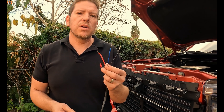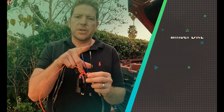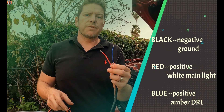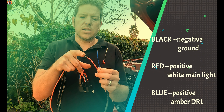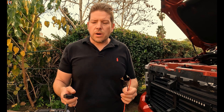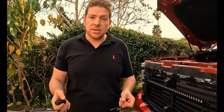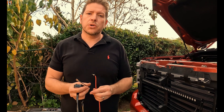When you look at the power cable of the light bar, it has three wires: the ground, the positive for the white light, and a positive for the DRL feature. We're using a generic wiring harness in order to connect the dual functions of the light bar. MNR does not sell the wiring harness, but I'll show you where you can purchase one on Amazon.